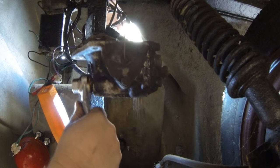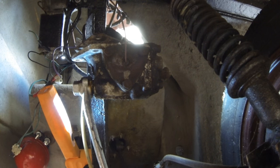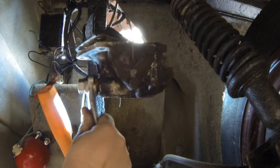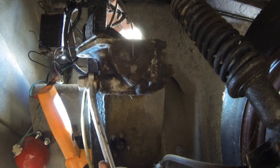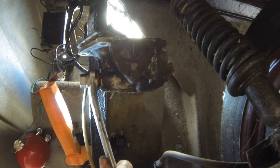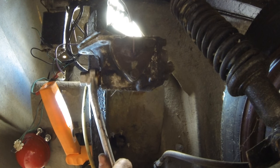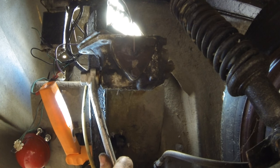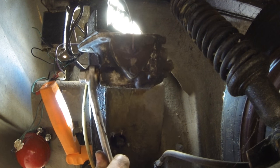Now I'm thinking that steering rack, the ball joint's just dropped out. Is there any brackets up there? Yeah, don't pull it. Go on. Bracket up here. But can you undo that? I've got a half inch. Yeah, 13 will do it. That's the thing, because it's 1967 this, it's all imperial, isn't it?